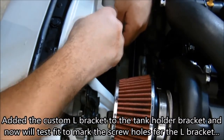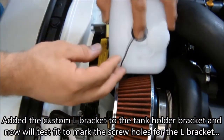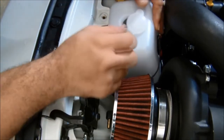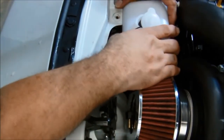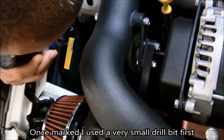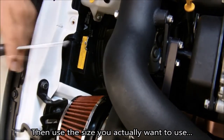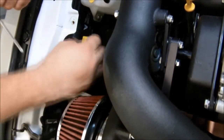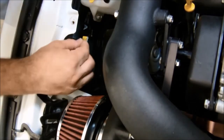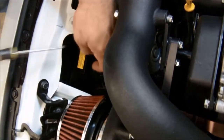This is how everything looks assembled — this is how we're putting the tank in the car. As you can see, it's a single unit: just put it in place or pull it out. It doesn't take up much space since it's a small bottle. We did have to modify the fan mount a little bit to make it fit without touching anything. That's not hard — we just measured and started cutting with the Dremel, then cleaned things up and used the L-brackets and the bracket that came with the kit to hold the tank in place.